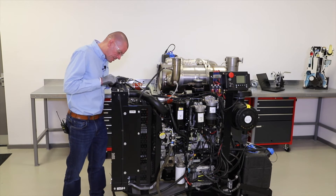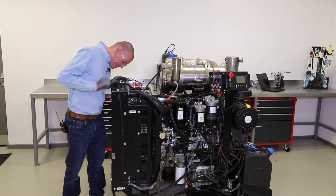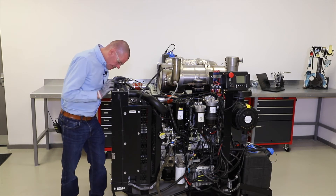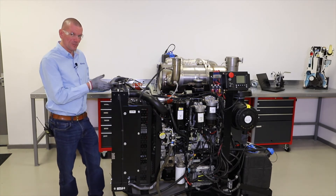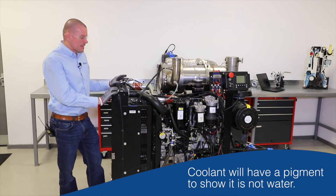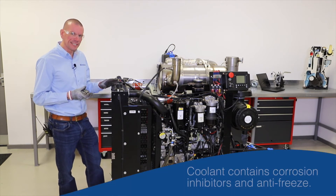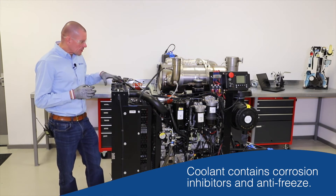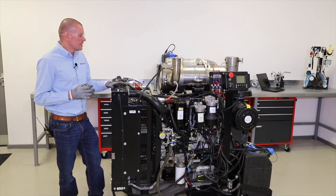I can give it a little shake and really notice the coolant wavering about in the bottom — I can see it connecting the bottom of the collar, very happy with that. One other thing I notice is the color — I can see there is a pigment in that coolant, which indicates to me it's not just straight water. We don't want to be filling a coolant system with straight water. Coolant contains very important additives such as corrosion inhibitor to stop corrosion on internal engine components.